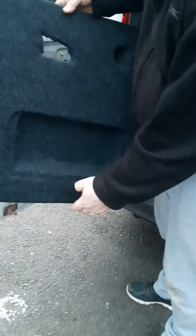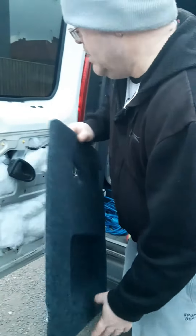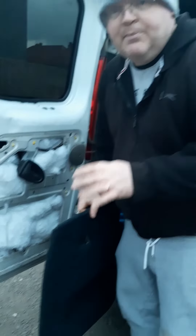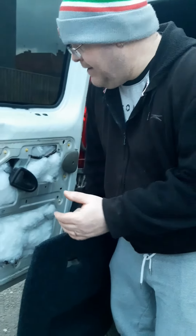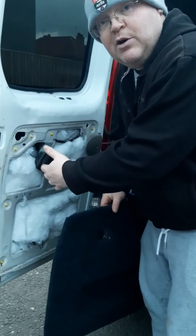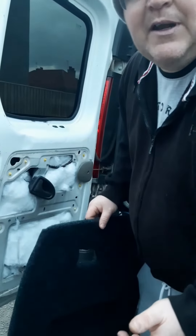This is the door card — it's all wrapped with the four-way stretch carpet and we're just ready to fit it to the door now. I've not bothered with double bubble wrap on the back here, only because we put insulation in there. What I should have done was add that to the insulation earlier, but we'll go and fit this and then do a before and after comparison.